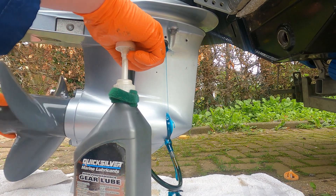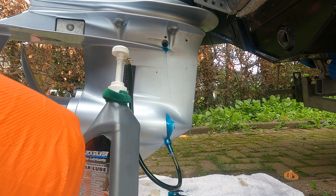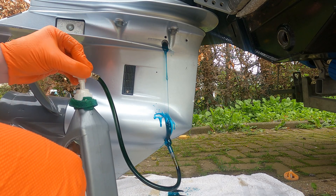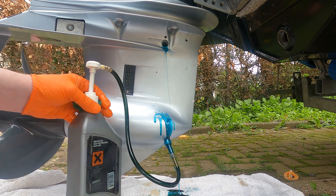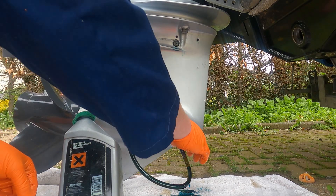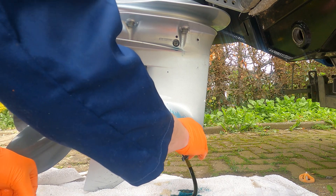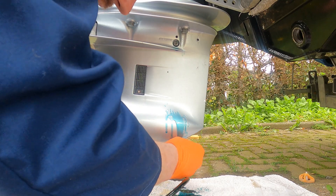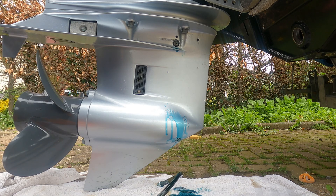There's the oil coming up the top there. So what we'll do now is put the top plug in, remove the bottom fitting, and then put the bottom plug in — the top one creating a partial vacuum. So it's as simple as that. I'll just put the top one in there, take out the bottom one much the same way, and quickly put the bottom plug in. Try not to lose too much oil. We'll just nip that up, trim the engine up, and nip that tight. And that concludes the gearbox oil change.